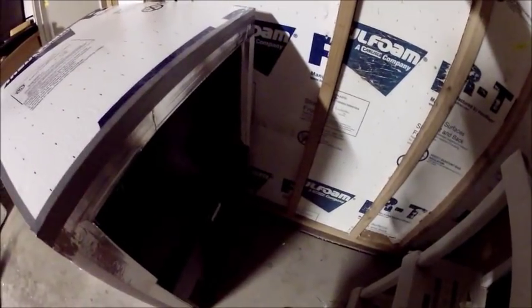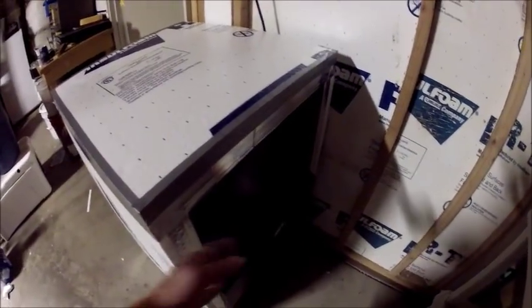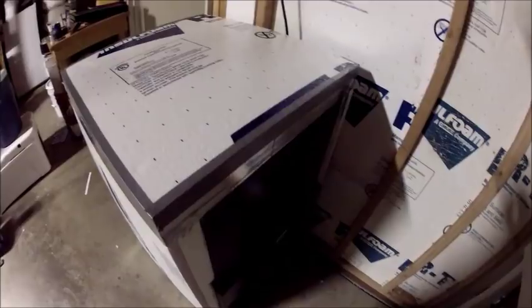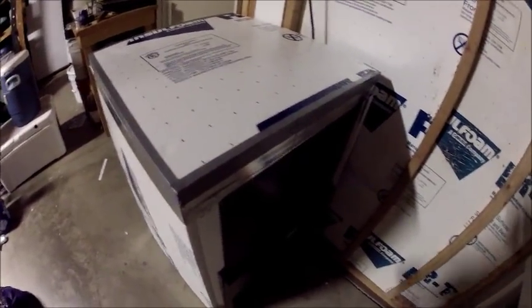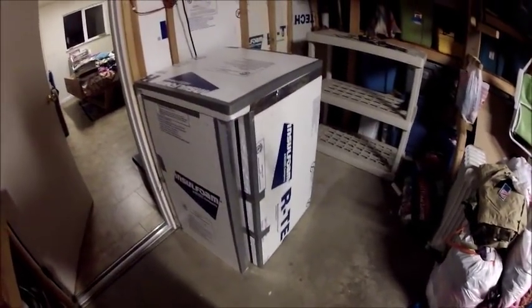I've got it positioned so this area gets a lot of airflow. The compressor needs a lot of airflow, so if you put it up against a wall it's going to be hot and cut down your efficiency. I've got it over to a gap where I'm going to try not to block it, so it'll hopefully have better airflow. We always stack fridges against the wall but fridges do need cooling — there has to be a gap behind the fridge for it to cool. Out here where it's going to be really warm, I want to have a lot of airflow so it can really blow air past the radiator. That's how you super insulate a fridge — fairly easy, not pretty, but pretty efficient.